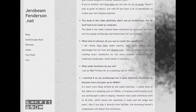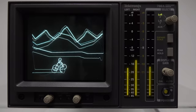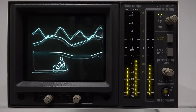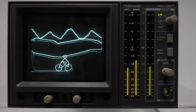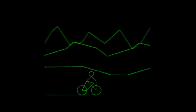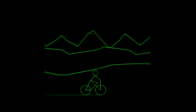You might find those video files are the best way to play back the content, because if you don't have a setup that can support 192kHz playback through your audio device, you might get the odd glitch on screen. On my setup, I was playing it back through a lossless audio device, but the interface doesn't go up to 192kHz, so you can see a few breakups on the bicycle and some double lines on the scenery in the background. If you play back the video files you get when you download the album, you can see that those are rock solid - the bicycle is drawn properly and there are no double lines on the scenery.